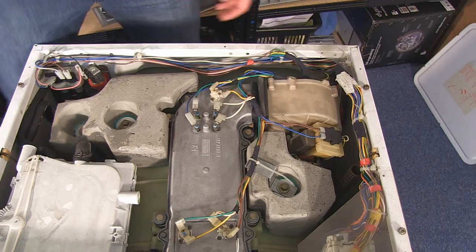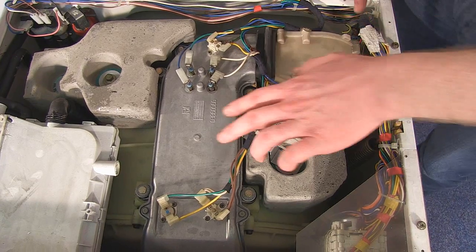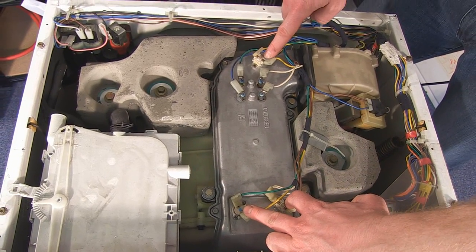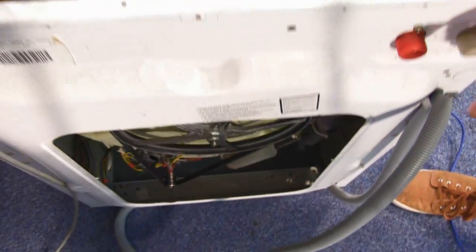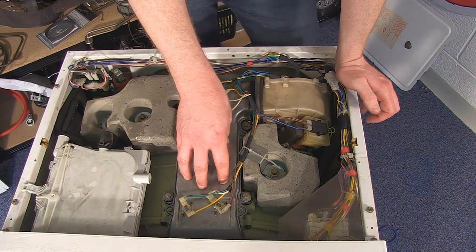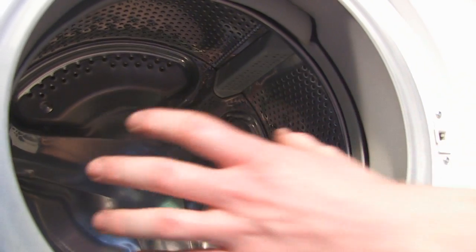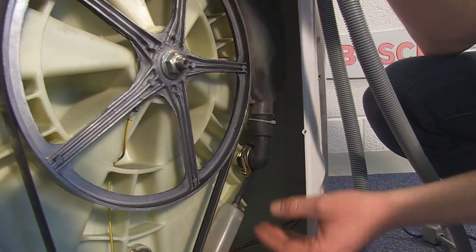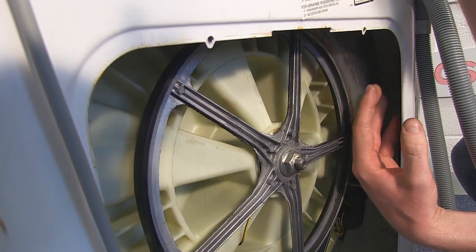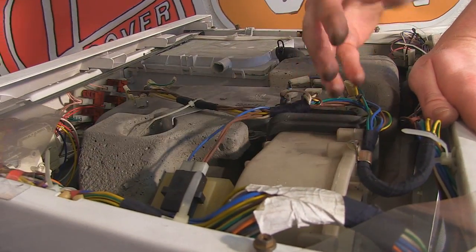Here we have the typical components of motor and fan, heater box with the elements and thermostats or cutouts, and at the rear of the machine is the condenser. The fan pushes air through the heater box. This hot air then enters the drum, and is passed through the washing load where it absorbs moisture. Moist air exits the back of the drum via this hose, where it enters the water-cooled condenser drawing out the moisture. This air then re-enters the fan and is heated again.